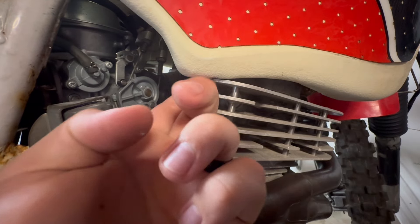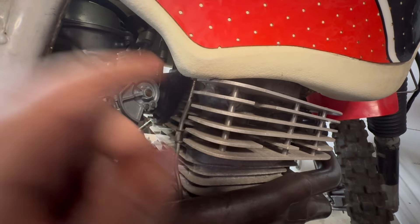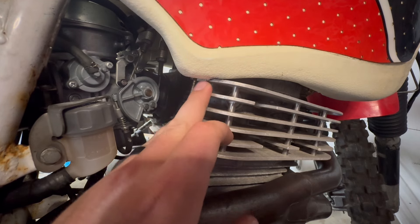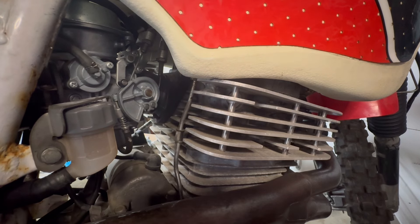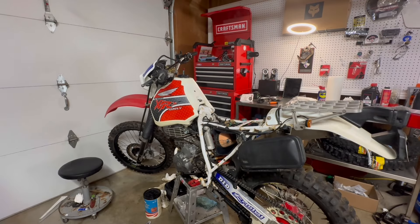I think if we just trimmed this top one on this side, and it's like the fourth fin on the other side, just a little bit — better peace of mind. The plastic from the tank is kind of getting eaten away, and the last thing you want to do is punch a hole in it and start a fire or something. Besides those two issues with rubbing on both sides, the tank is mounting up well. The new rubber mount made a world of difference compared to those stacked washers.